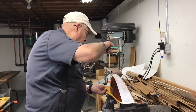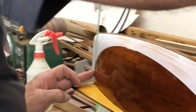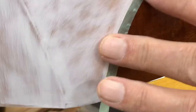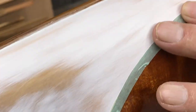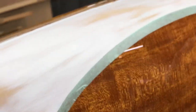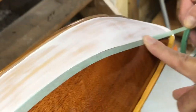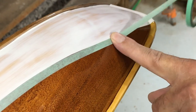We're going to tape to put a first coat of gloss on the white topsides. When you're taping, this top line will go on real good. But if you were taping over the white to do the varnish, it would wrinkle — see these little wrinkles? You've got to really press them down. I use a little wooden tongue to press it, but sometimes that doesn't work, so you really have to be very careful because it'll bleed on you.